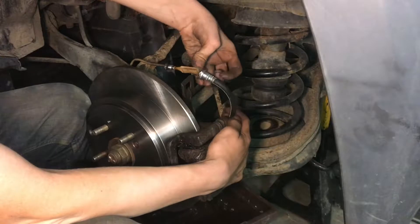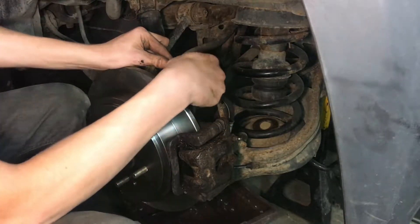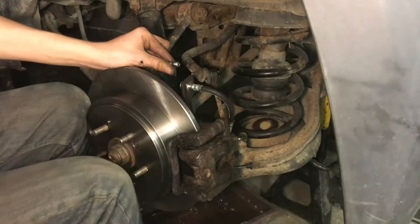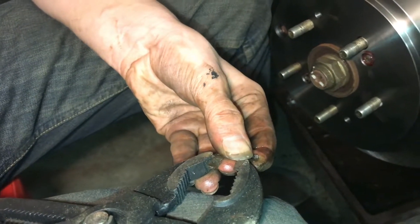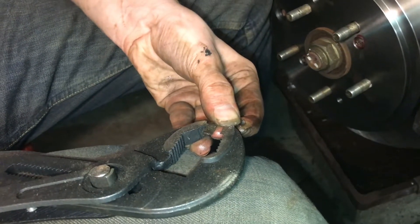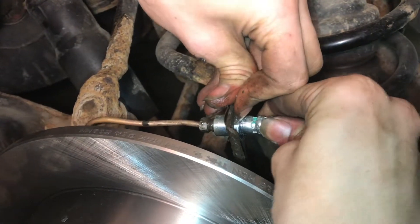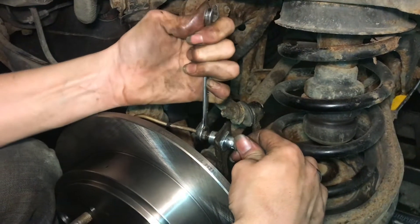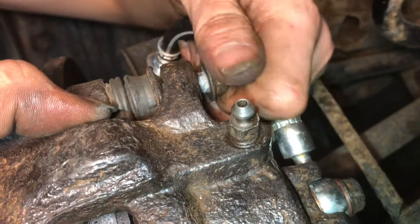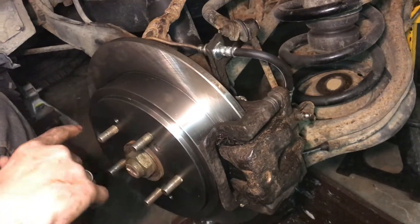Now we can go ahead and put the caliper on — I'll slide it over our new brake pads and this hose will swing around and go through here to clip and hold it in place. I can take out this wood plug that's keeping all the brake fluid from leaking out, and we'll start threading everything together. This clip needs to be squeezed down a little bit — over time it's stretched — so I'm going to carefully bring it back down to its original size with pliers, then clip it in place and tap it in. Now we'll go ahead and tighten up the brake line and put the guide pin bolts in.